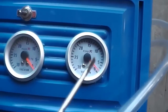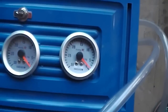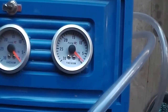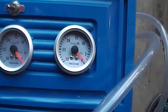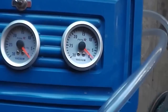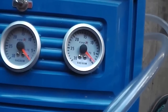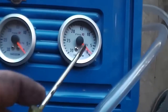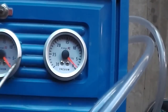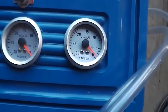The third gauge is a little bit too high on vacuum, which means the throttle was a little bit too closed. So I need to basically open the throttle a fraction just to drop it down the fraction it needs. Because it's sitting up a little bit higher — about two notches past five — and these two here are sitting perfectly on one notch past five.